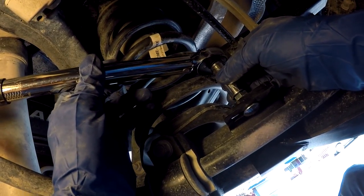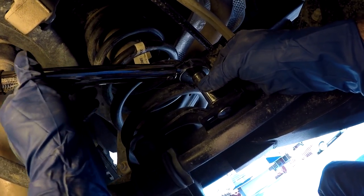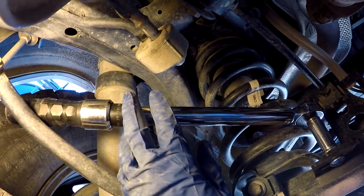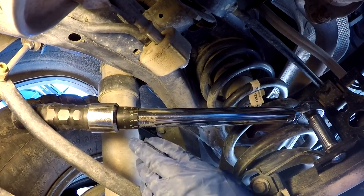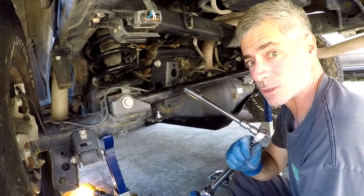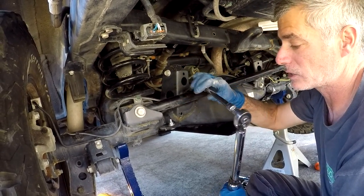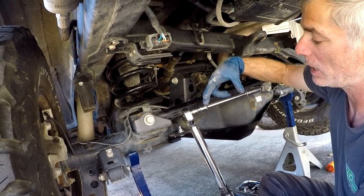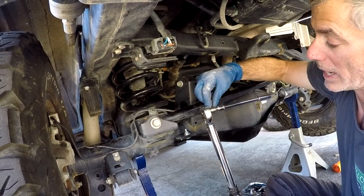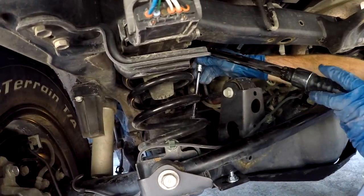On the underside of the vehicle, on the passenger side, with the long 14 millimeter socket there's just enough room to turn the ratchet towards the shock absorber to get it to torque spec. Garrett spotted that we can come in from the rear for the front bracket on the driver's side — using a medium length 3/8 extension, a short one-inch extension, and a deep 14 millimeter socket, we can get on top of that nut and hit 30 foot-pounds.